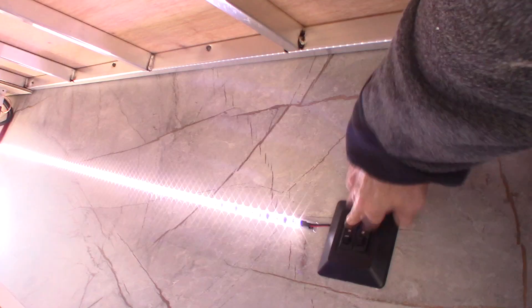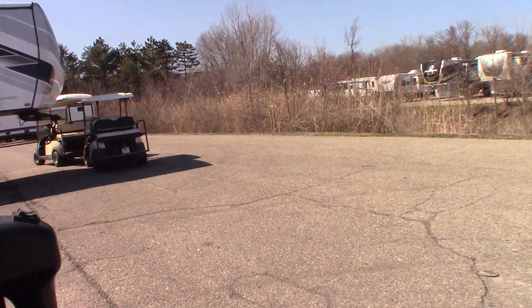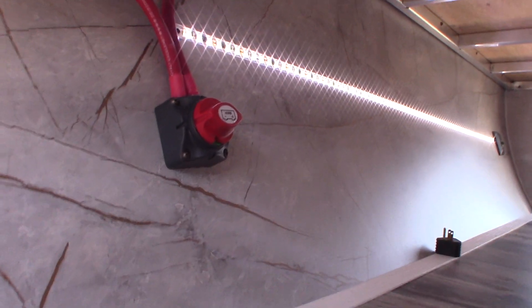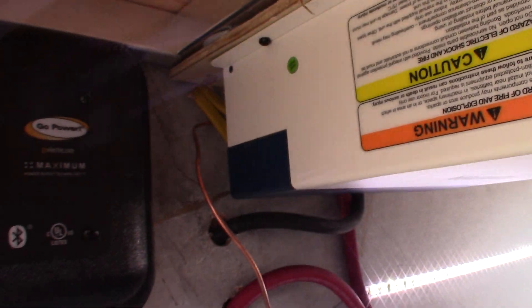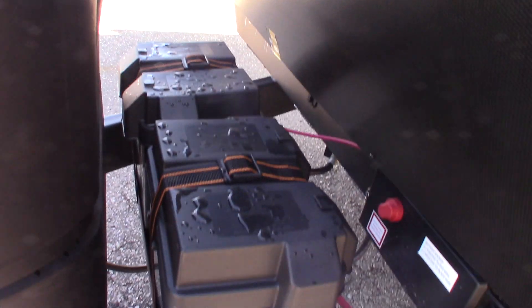You have lights here. Looking through the pass-through: this one has a solar panel, there's your solar controller, and it has an inverter. You requested two 6-volt batteries wired together as 12-volt, which is the best way to do it because you get more storage.